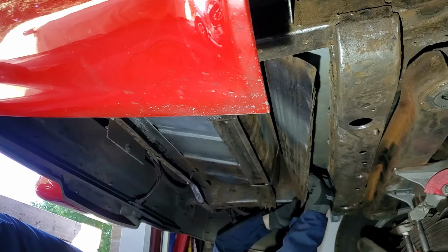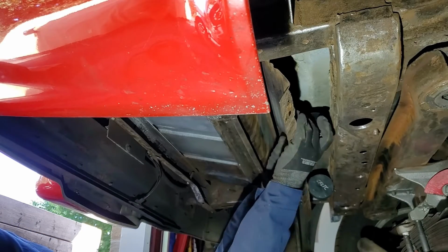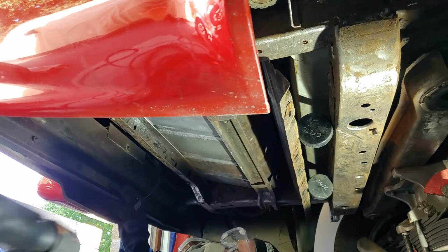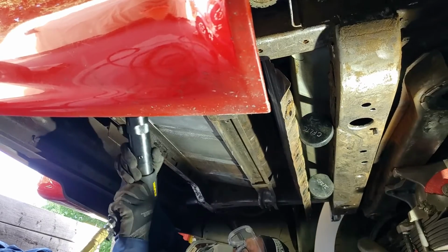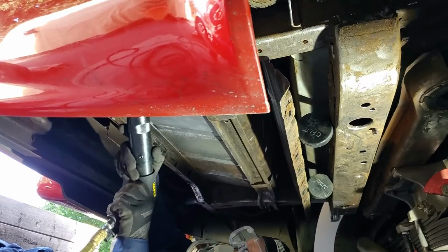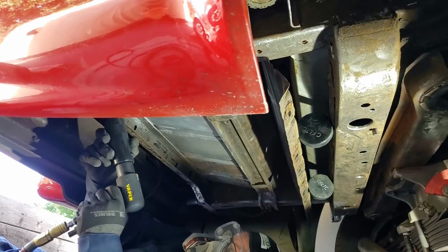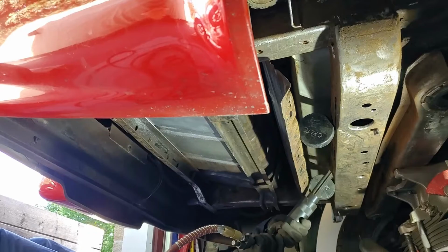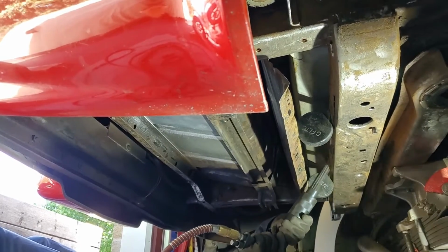These hockey pucks are turning out to be pretty useful. I'm just using them as wedges to keep this sheet metal part open. I'm using a needler here that attaches to an air hammer, and it really helps get rid of a whole ton of debris right off the metal. It's a really useful tool if you decide to do this type of stuff.